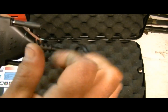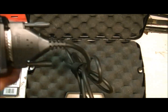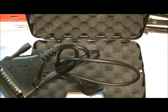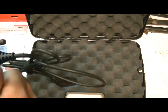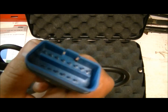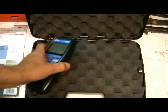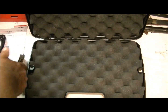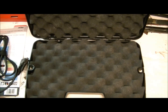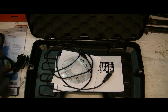Here's the data link port where your cable plugs in. When hooking up the link cable, turn the screws until they stop on their own, then give each side one small extra tweak — that's secure. Do not over-tighten; it's not good for the connectors. The other end is your OBD2 connector that plugs into your car's data port, usually on the driver's side under the dash. It also comes with two batteries, so you're ready to scan right away.